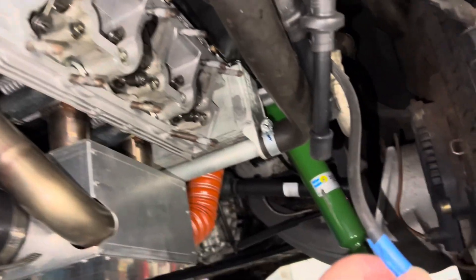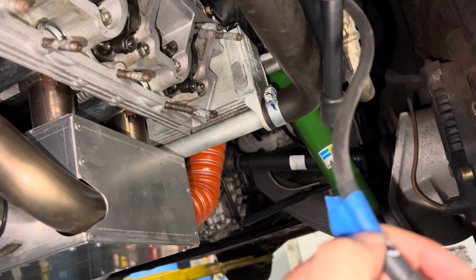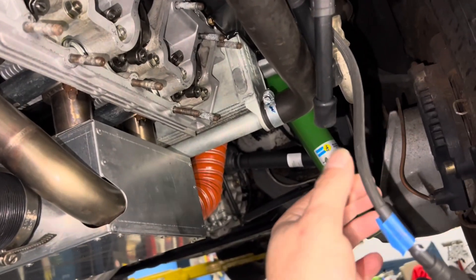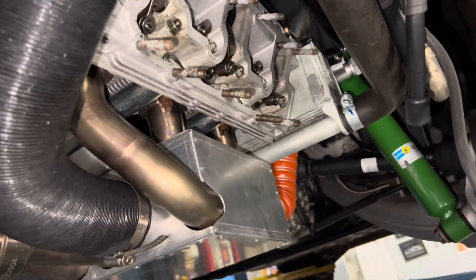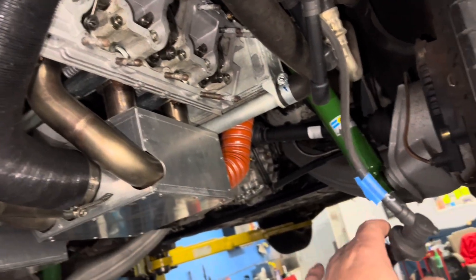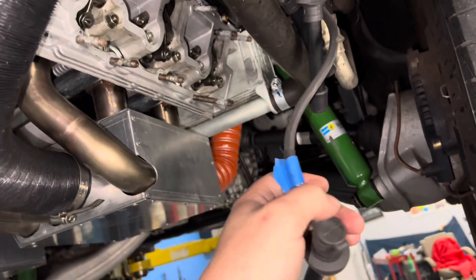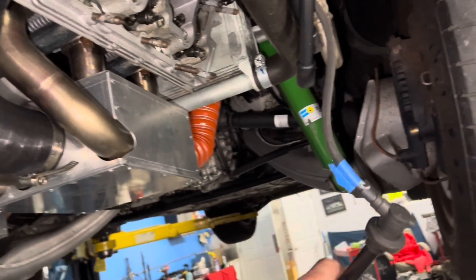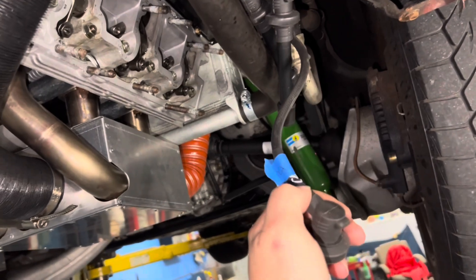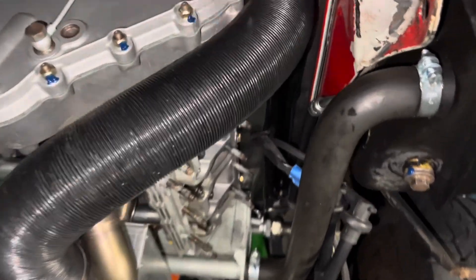When you've got these twin-plugged things, you'll notice I have numbered the plugs and wires — so that's number four, and I know where to put them back. I had those little number loops on them, but those don't work on 911s — I learned that on this car. The last set of wires I ordered, directly from the guys who make this for Cluet, I had them put wire numbers on the actual heat shrink, and that works out really well. If I had it all to do over again, I would make sure to get that handled. That would make life easier.